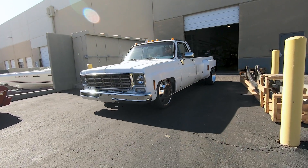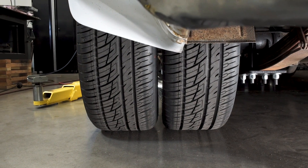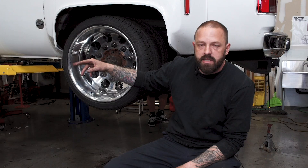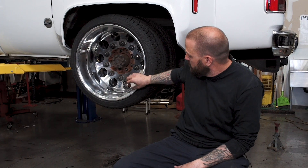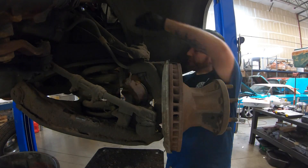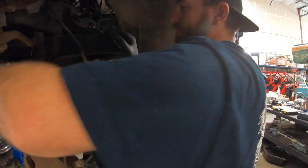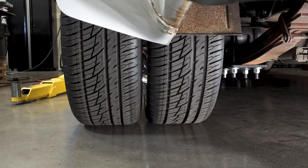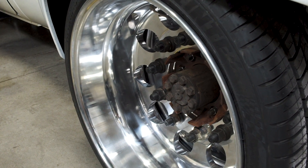We order just over-the-counter 22.5 eight-and-a-quarters. There are three standard sizes in these wheels - typically a 22.5 seven-and-a-half, 22.5 eight-and-a-quarter, and then the 22.5 nine. The aluminum wheel allows us to manipulate the bead seat to mimic a passenger car hole size tire bead seat. On Dino's truck we're using eight-and-a-quarters on the front, eight-and-a-quarters on the inside, and then a nine-inch wide steer wheel on the outside rear. You would never know that's a shallower wheel than the normal dually style wheel.